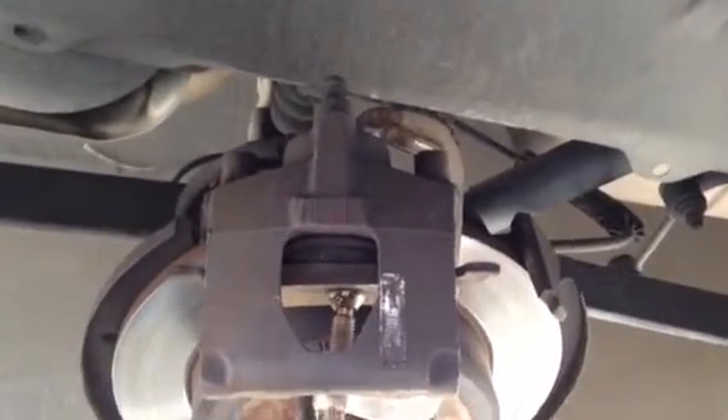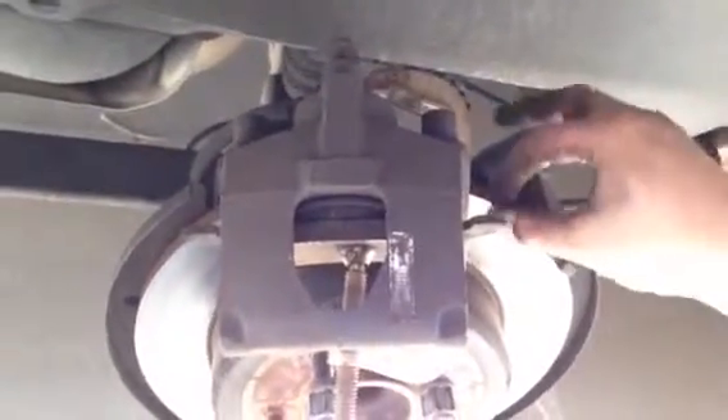So you're not going to have a mushy brake pedal or anything like that later. You can push it in all the way or just far enough to get both brake pads in place and the caliper back on. Once you get everything to sit back together, start screwing it back together. Once reassembled, have someone step on the brakes — don't turn the car on yet. Just have them slowly push the brakes down; they'll probably feel them go all the way to the floor. Pull your foot off, let the brakes come back up, then slowly push down again. What you're doing is getting the cylinder to extend so the caliper can grip, then it'll center and align itself for safe braking.